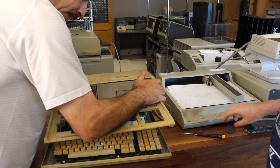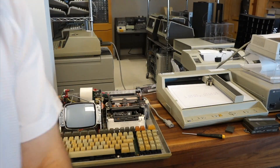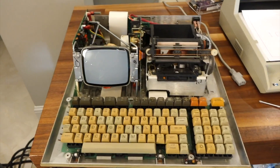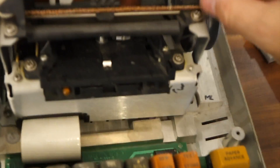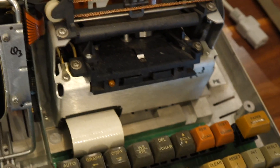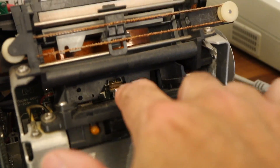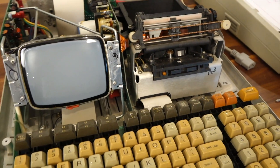Watch folks — beautiful HP hardware. He hasn't replaced the belts. So that's the typical HP 85 you'll get: the belts are gone, and you have to replace the two belts for the printer. It's not hard and you can buy them. Much harder is the capstan. The printer would be nice to replace the belt, so I'll let you do that.